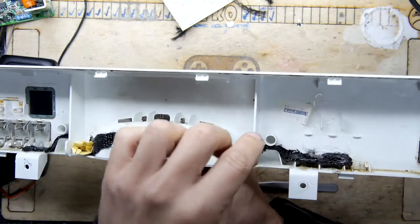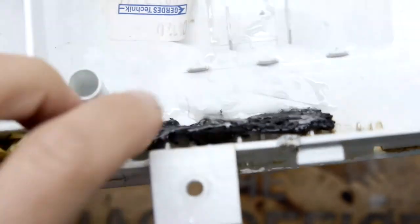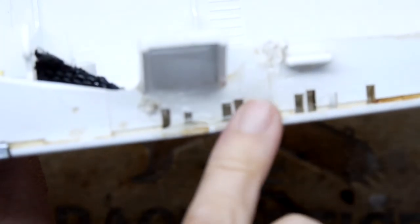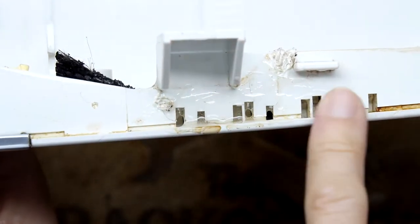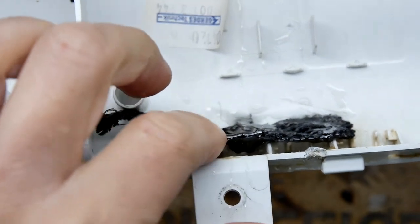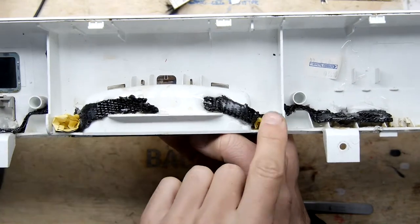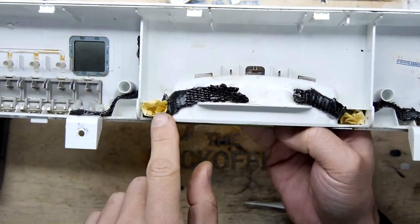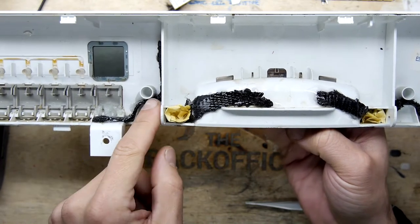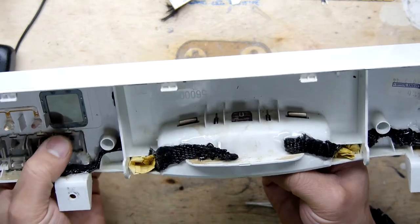You see there, there's a nice cavity. I actually placed that one so that it's made a cavity behind. You see there's a gap there, but I've also put resin over the holes because I didn't want it to leak out of here. But I might put one piece of tape over there temporarily because I want to fill this with the fiberglass reinforced resin. So this will be a really big tough block there. I might take out these bits of paper if I can and fill it in here and here as well. Maybe fill in this cavity as well and try to get a little bit more in this edge. And that's it. Then I'm going to pop it on and that's the best I can do, I think.